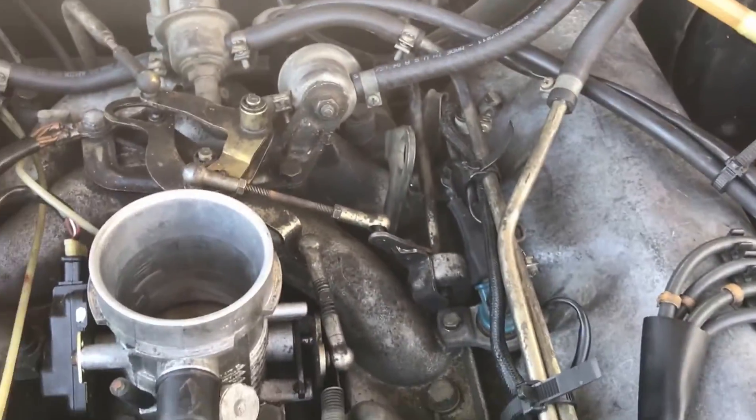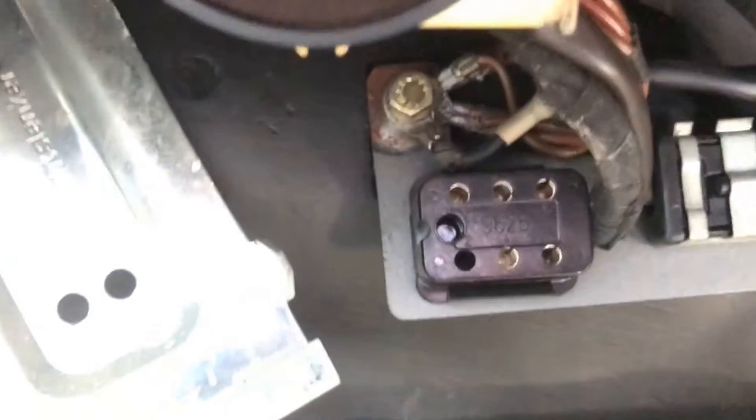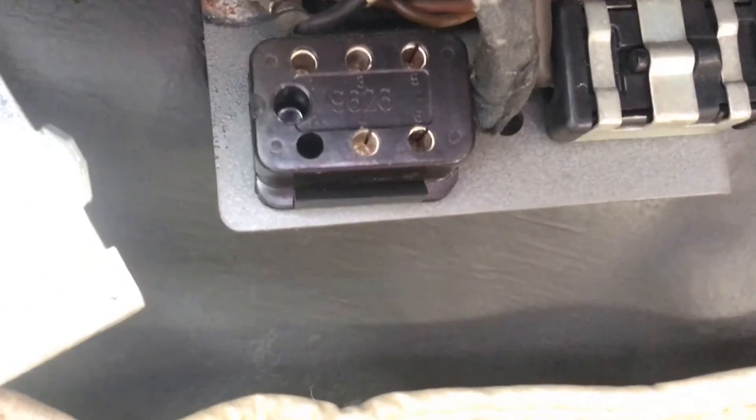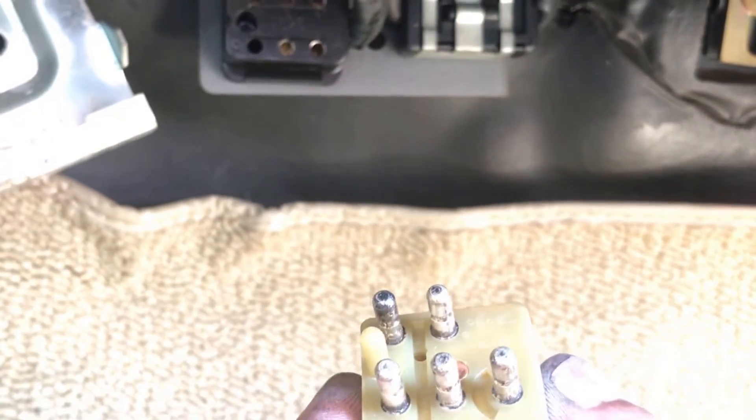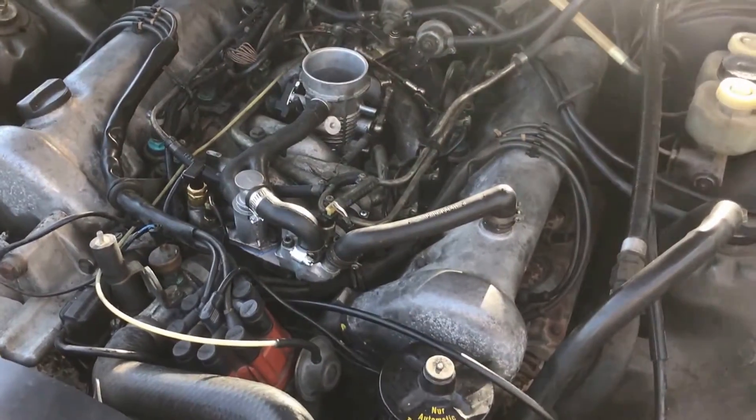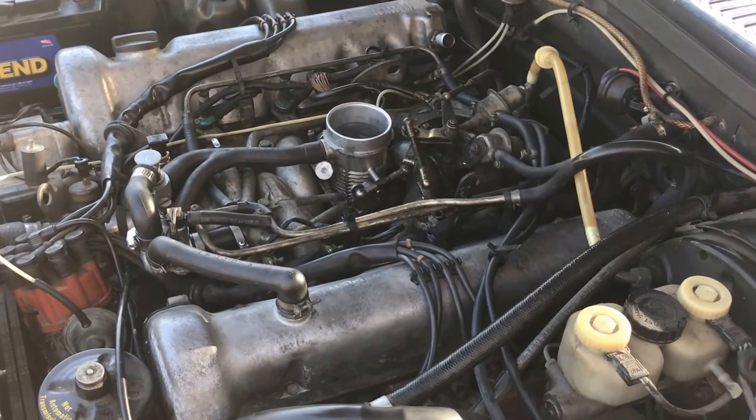All the injectors are locked back up. The easiest thing I found: put the o-rings in, slide each injector in, then put the rail on all at once. Also found — looking in the service manual — under the dash right by the blower there is a fuel injection relay. Pulled it out and these pins — one goes to an empty hole, and the other one at the bottom is reversed compared to my relay.